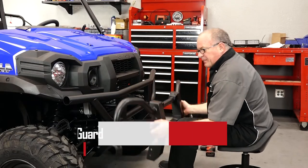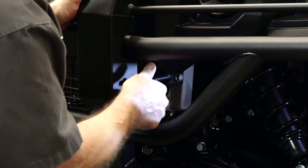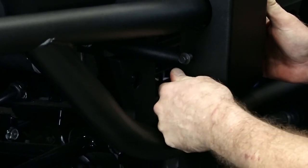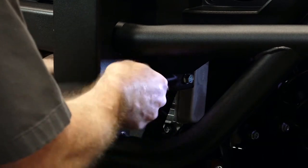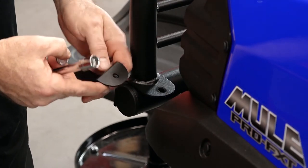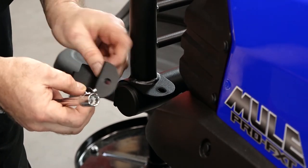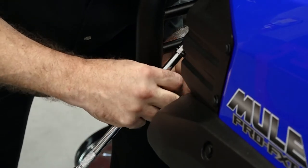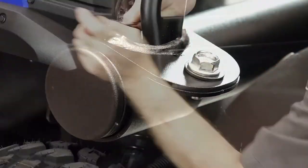Let's lift her up in place. Kind of let it balance up on the top, try not to scratch anything, and slide it up. What I typically do is aim for just the top bolts on either side first — top one's in. Let's get the bottom ones to go in place. We don't want to tighten them up yet because we still want the bumper to be able to move around as we put the other mounts on it. Now we're going to use this half clamshell — you'll notice it actually has a little nut tack welded on there. Before you install it, make sure there's no slag from any of the weld getting on the threads. This just hooks in the bottom — put a little pressure in with your shoulder and that bolt should start right up. Then we'll do the same thing for the right side.